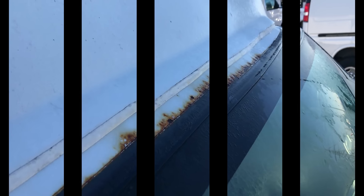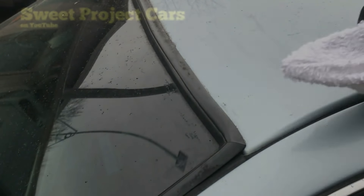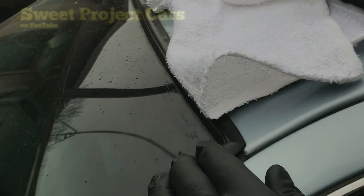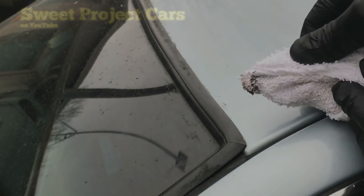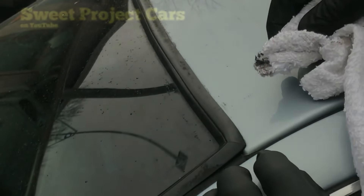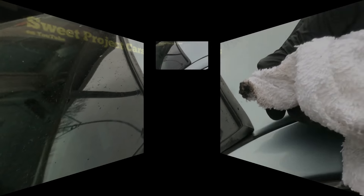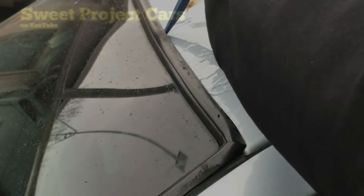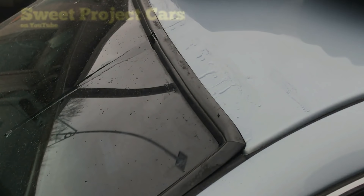Here's the other type of seal right here. You take your panel tool, go underneath, put this rag right here, and run it down through there. That debris right there is why they rust out — and I'm telling you, it slides right down through there like nobody's business. Look at all that dirt. Now that you've cleaned it all out, you're good to go. Take your panel tool, apply the mineral oil, and let that soak in — this will not rust out.